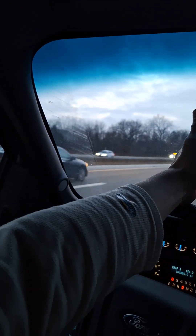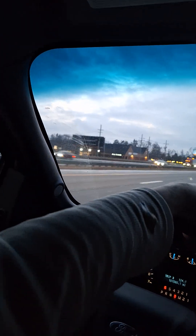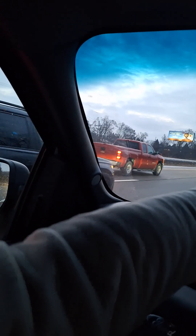It doesn't do it anymore. I went to the Ford dealer — did not replace the pan gasket — but changed the filter and fluid, and now it quit doing it. So changing the fluid and filter solved the problem.